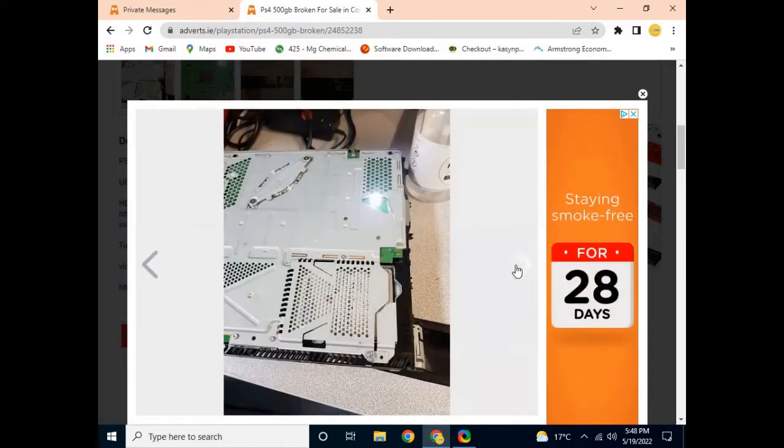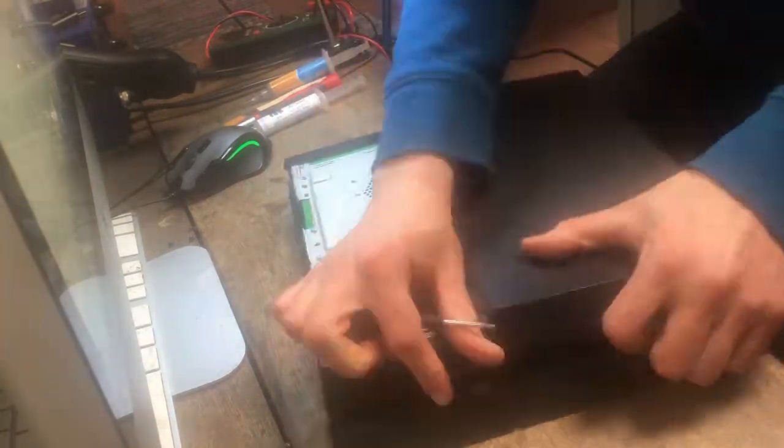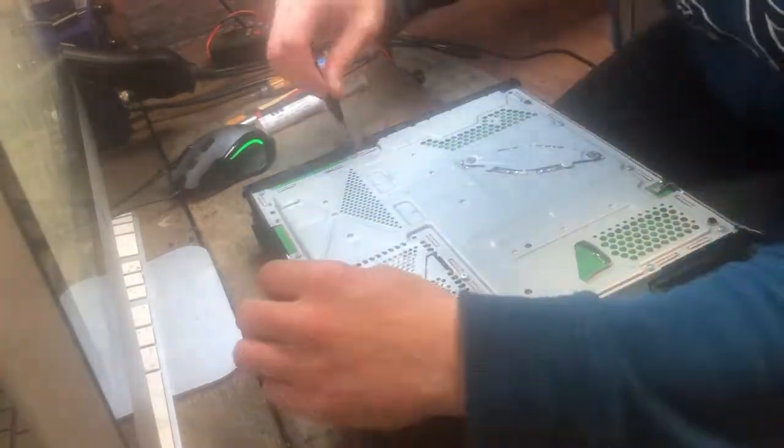Because there was work carried out on this, the first thing I'm going to do is take it apart, look at the HDMI port first, then check filters and diodes and stuff like that. If none of them are the problem, I'll go ahead and change the encoder.